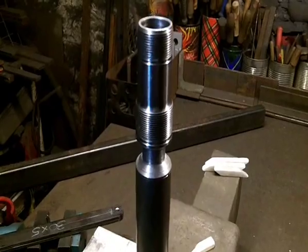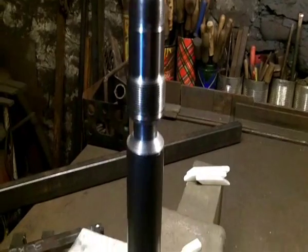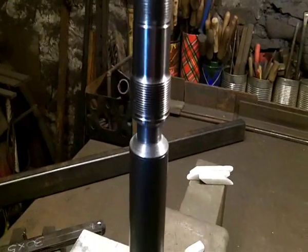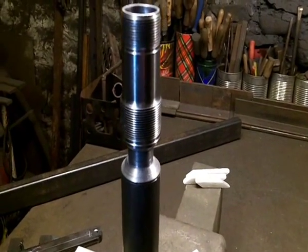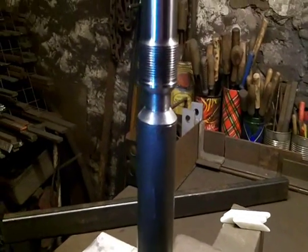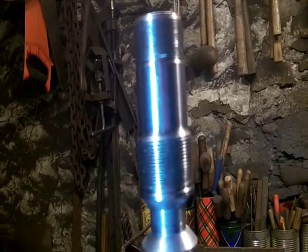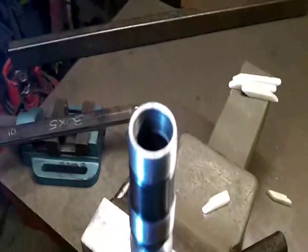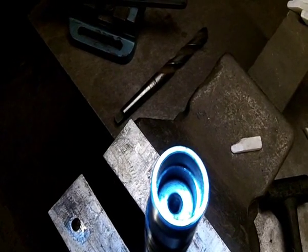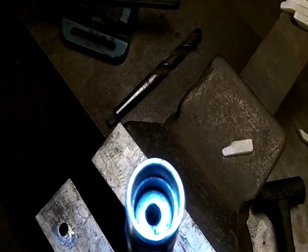Right, so here we are hammering on the top part of the steering stem spindle onto the inch bar for the bearings. As I say, this is so that I can fit any custom front end, but we're originally fitting the Triumph Trident yokes onto it, or triple trees as you call them in America. So as you can see here, I've made it an interference fit. You can see that I've V-prepped both of them because I'm welding them, but I'm having to chap this down. It is nice and tight, and if we can see inside here, we'll try and get the torch on that. What I've actually done is I've machined a wee step on there, and I've threaded the top of the bar with an M6, which is 1/4 inch.